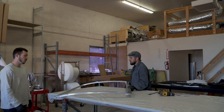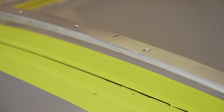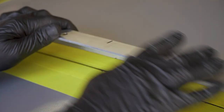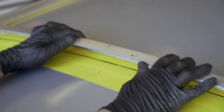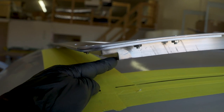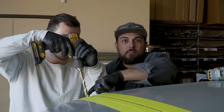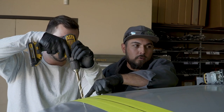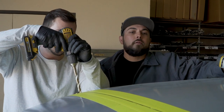Now what we'll do is take it to the roof as a complete frame. We already pre-marked the roof center on this particular vehicle. Mark center, found it at the bottom of the windows. Frame's marked center — get them lined up, have them at the front. When you're marking the roof for the side frames, you'll cut the roof out for this line, not for this one. To get the hole — the roof cut — best bet, and to keep from stress cuts down the road, drill a hole in each of your four corners. That also makes it so you can drop your bit in the hole and connect the dots.